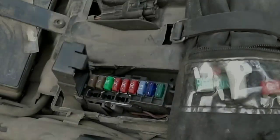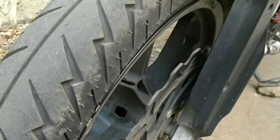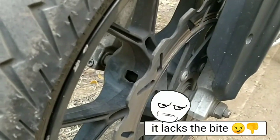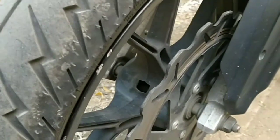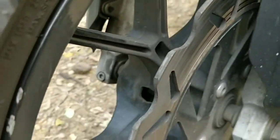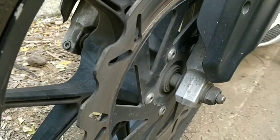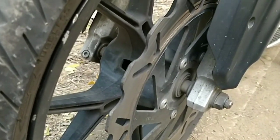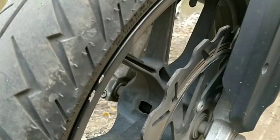There's one more thing I would like to add — the disc brakes. Many people have recommended that Mahindra should upgrade their brake pads and everything. I would really say yes, that's an issue, because you literally have to press the front brake very hard. I even have markings on the brake lever — you can see that — because the brake pads get worn out much earlier than they're supposed to. I have to change my brake pads in less than a thousand kilometers, which is very costly. For a front brake it costs around 2,400 rupees and for the rear brake around 1,500 rupees — very costly for just a thousand kilometers of riding.